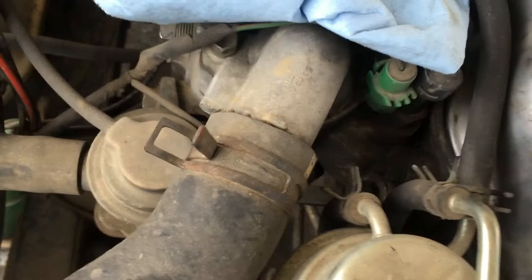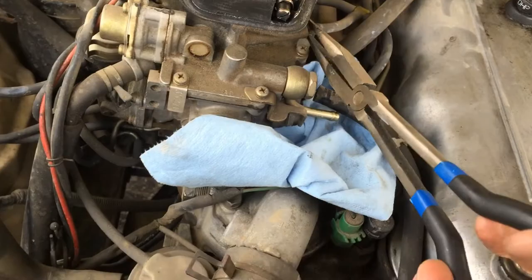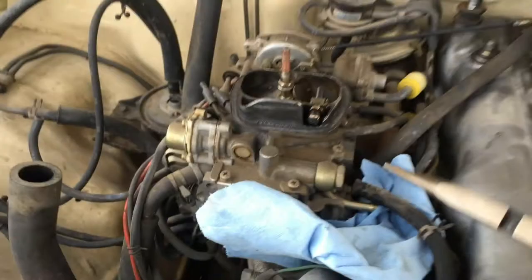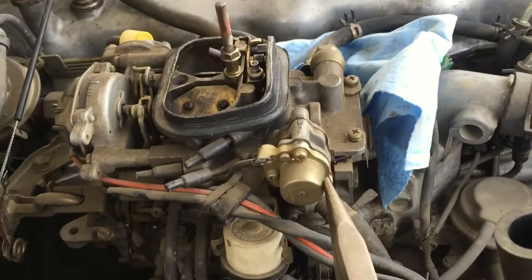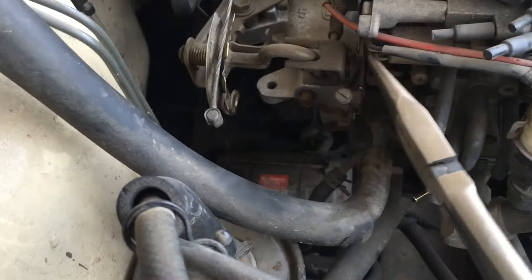Let's not do drugs kids, it's bad for you. I'm gonna disconnect this vacuum one, and this one, and this one — nope not that one. I don't need to disconnect that. The BCV line — the charcoal canister line needs to be disconnected. A pink fuel shut-off solenoid, or maybe the electronic choke. Any of these little vacuum or electrical lines headed to the back — nothing coming off this junction block looks like it connects up to the carburetor, so I'll just pop this guy out.